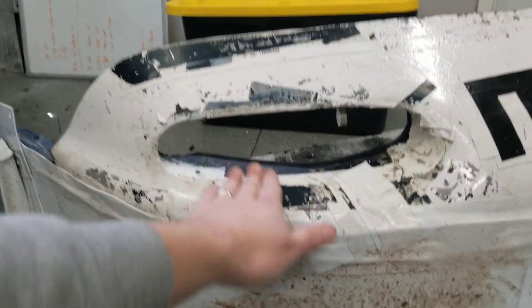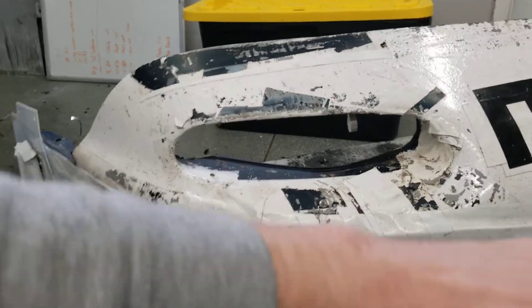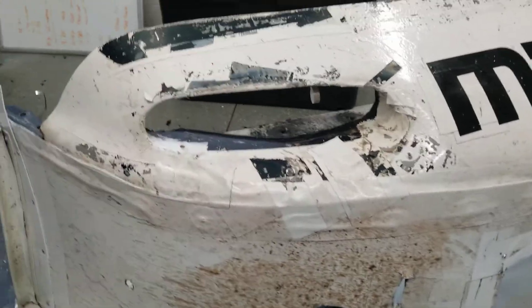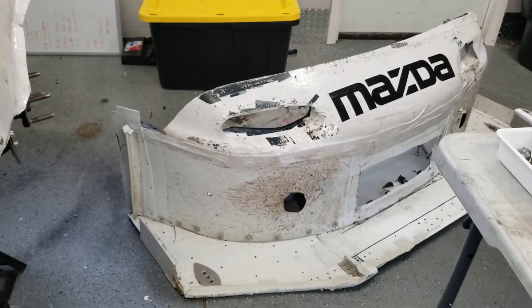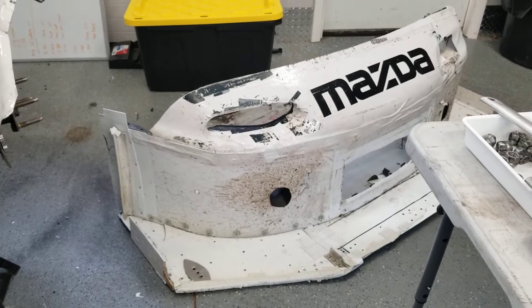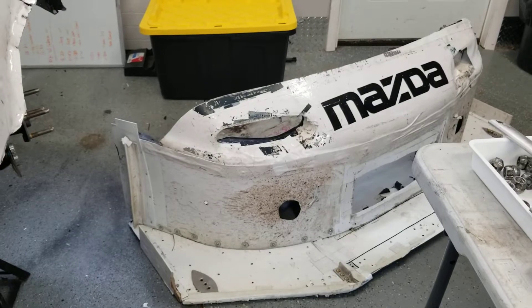When this is made up, we tape in here to create that smooth channel, so it's connected straight into that sealed air box. Hopefully the air is directly hitting this — maybe it's manipulated a bit with the airflow down, but the air comes in and creates positive pressure in the intake. I also wanted it higher up because a bigger difference in actual performance is going to be the temperature. I wanted to get as far up off of the track as reasonable without seriously impacting the flow on the car.